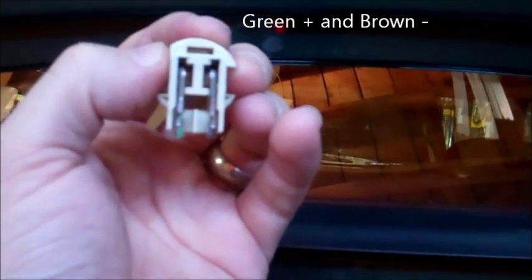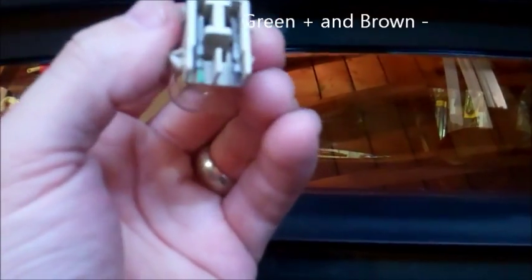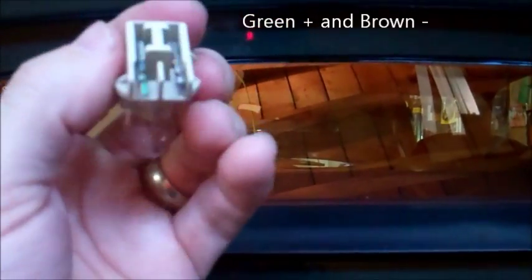You can see all the wires hanging loose. Over here is where I connected in — this is where the old bulb used to be. I just cut the old bulb off and snipped the wires right at the base, then stripped them and used those wires to connect into all these wires I've set up on the LED strips. Then crimped them together and heat shrinked them together, and that's about it. We'll do a little more cleanup and hiding of the wires in a minute.